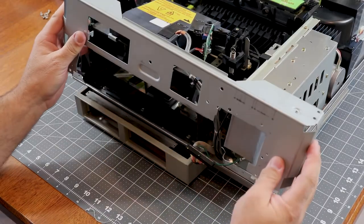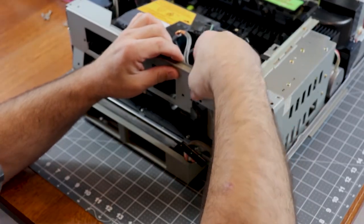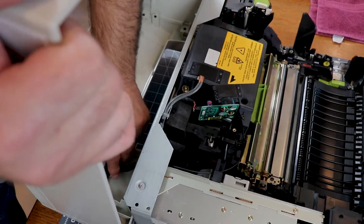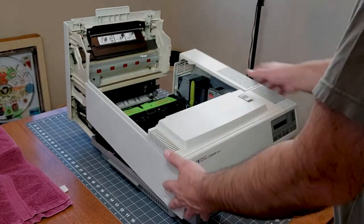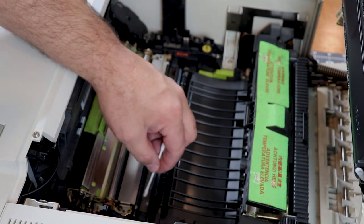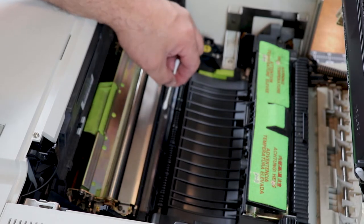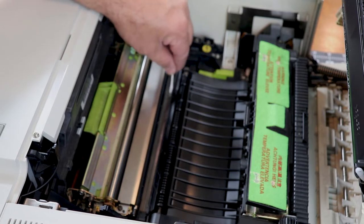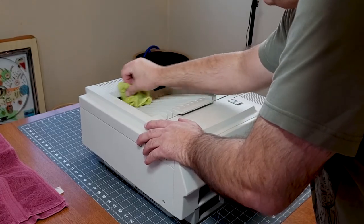The front support plate slides in from the right side around the cables. Reattach the wire restraining clamp and ground wire then secure the plate with six screws. The cover is installed by standing it on end so you can attach the display cable, then rotate it down into place and reinstall the eight screws. Finally, I clean the transfer corona with a cotton swab and alcohol — be very careful when cleaning the fine tungsten wire, as this wire has about 5,000 volts on it when printing to generate the static electricity needed to attract the toner from the drum onto the paper. I also did a cleaning of the inside of the cover and the outside.